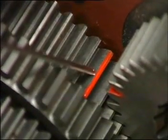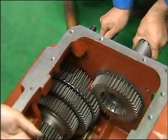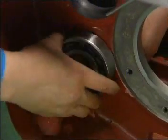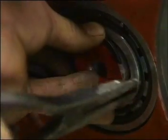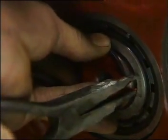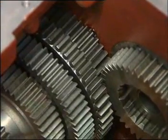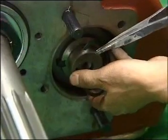Time the left countershaft gear with the input shaft gear. Load rear bearing 102308E of the countershaft assembly and use a copper stick to knock it to right position showing up the stop groove, then mount the stop ring to right position with pliers. Check the timing of the input shaft gear and countershaft drive gear, and insert the front end stop ring of the countershaft into the groove in the front of the countershaft.